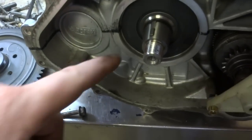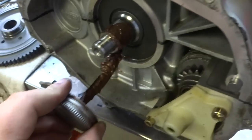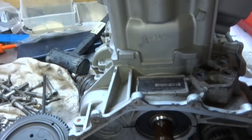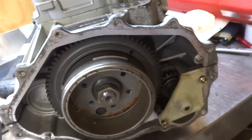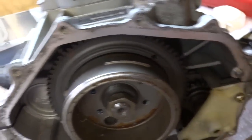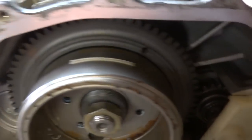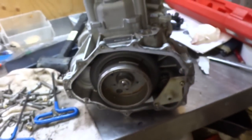For this part, you want to put some anti-seize on here, but make sure that key is in place as well, and go ahead and grease up the shaft. Put the flywheel on now — this is important, it has to go on a certain way otherwise your engine is never gonna start. That hole right there has to be after the long piece. There are a few short knobs and one long one — that hole has to be positioned just like I showed you in the video. Then tighten that up and this part's done.